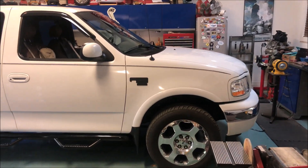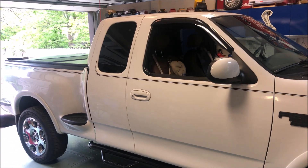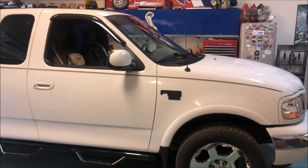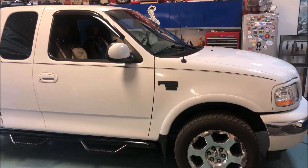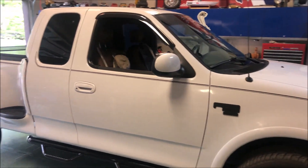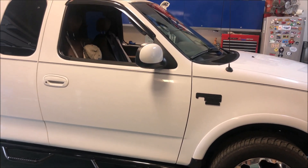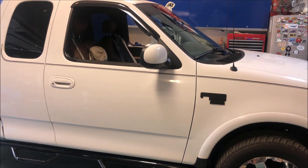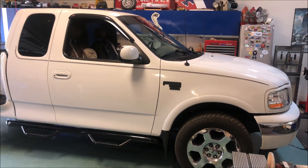Hello, Driving Intelligence community. This week I ended up with a check engine light, and that was after I was having some really poor performance. I thought I was having transmission trouble — it wouldn't shift or downshift. I got poor performance, felt like it was really sluggish. Then the check engine light came on. I was getting really worried about that transmission because it is old — 245,000 miles. Well, it turns out it's the throttle position sensor.